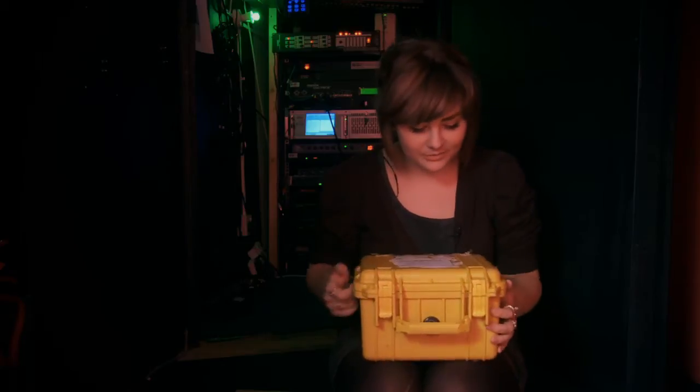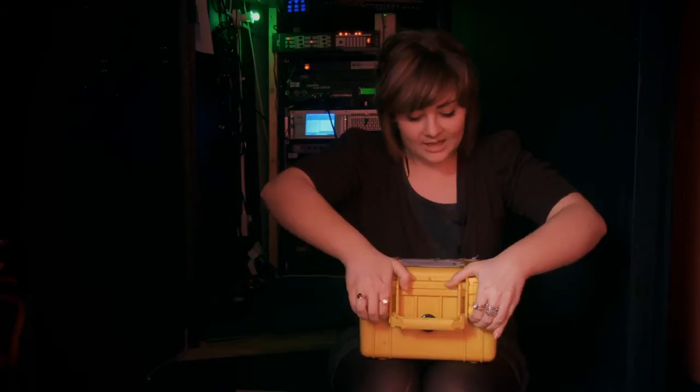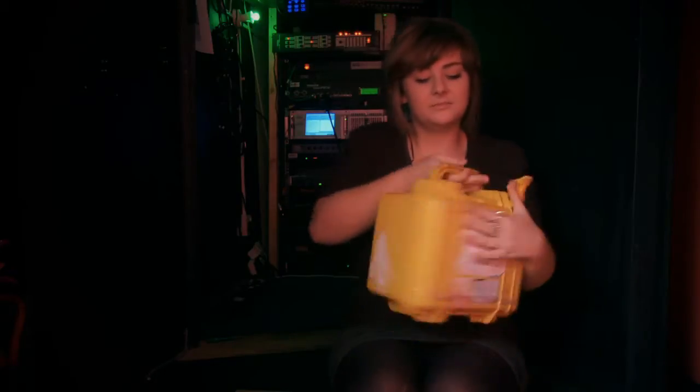This is a hard drive for the digital screen in screen 2, and basically they come in this big yellow box which is really hard to open. The digital projector works the same as a computer. You have to set up a playlist for it with the lights and the adverts before it. You upload the film from the hard drive onto our server and they're encoded, so then you receive digital keys in order for you to play the films for a set period of time.